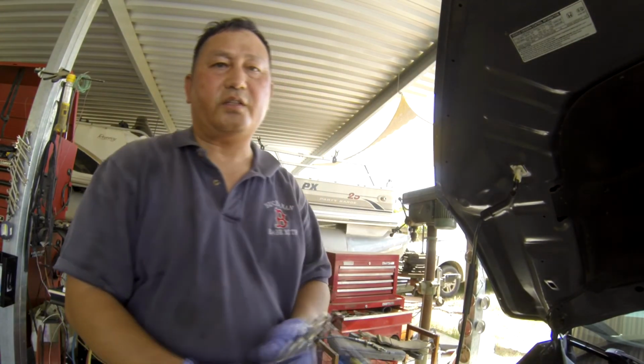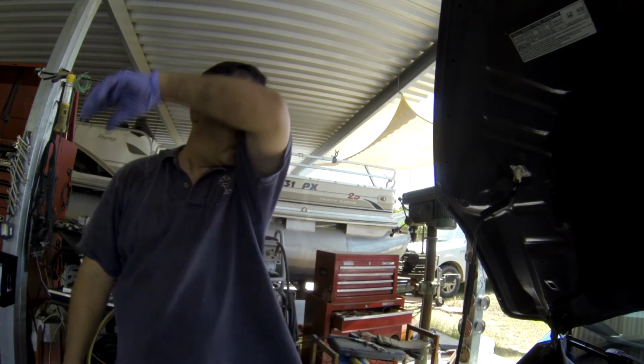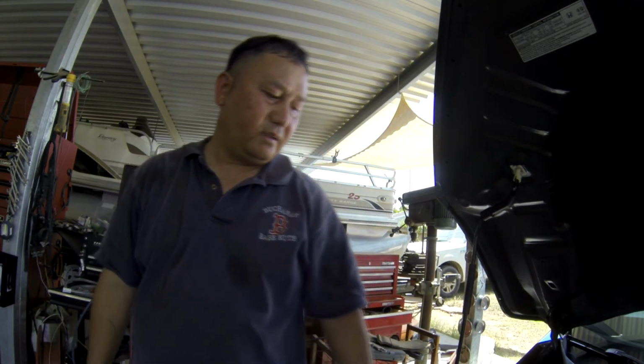So the rest, you'd just waste your time to watch. Don't forget to put your coolant in, because you opened the line and coolant leaked. So make sure to top off your coolant. Maybe half a liter, you know, 13-14 ounces of Honda coolant, or drinking water should be fine with that.